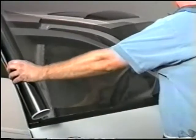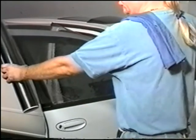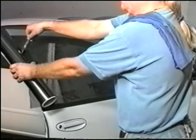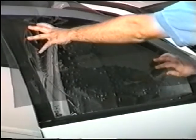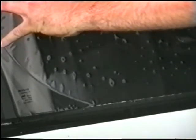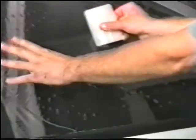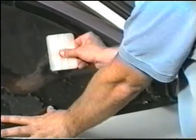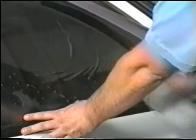When placing film on the window, be sure the liner side is facing you. All film has a clear liner on the adhesive side that must be removed when we do the installation. Be sure the factory edge is then butted to the top of the bottom door gasket. This is to guarantee a tight top border with no light gap at the bottom edge. Using your hard card, tack the film down. This is to avoid any slipping of the film that could occur during pattern preparation.